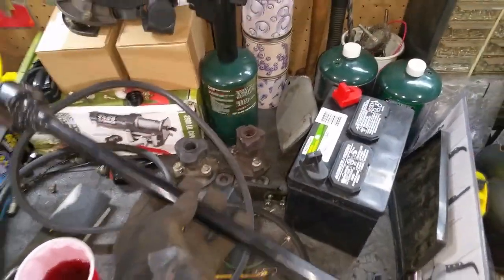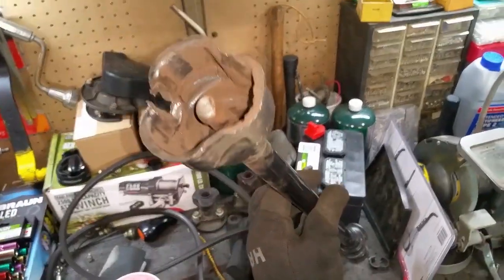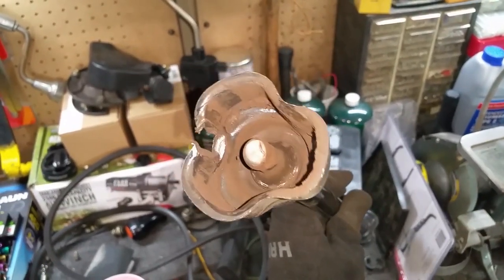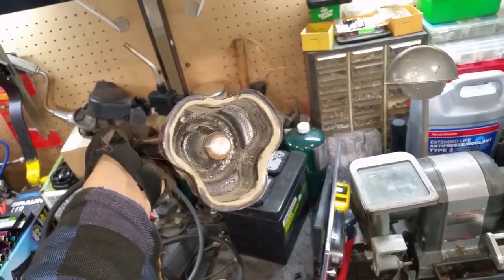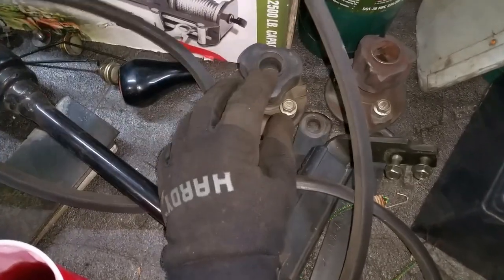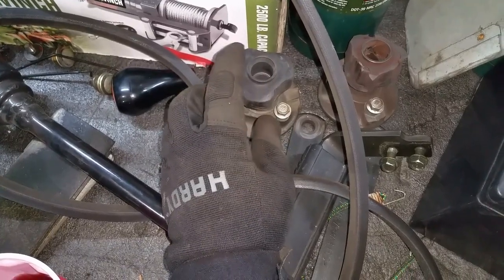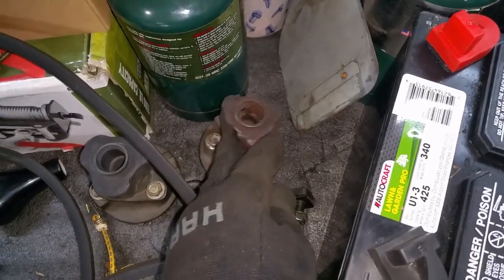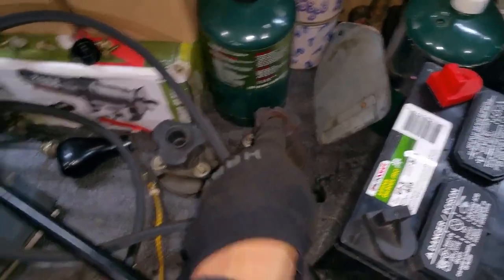Here's the drive shaft — it's a pretty good sized drive shaft, maybe about three to four feet long. Here's the front where it was hooked up to the flywheel; that damper basically destroyed itself and then started destroying the shaft. On the backside where it goes to the transmission, you can see the back one is in pretty good shape — it's missing the plastic collet that goes in there, which I did break when trying to separate it from the shaft, but that's easily replaceable. The front one is really in bad shape and was the cause of the drivetrain problem.